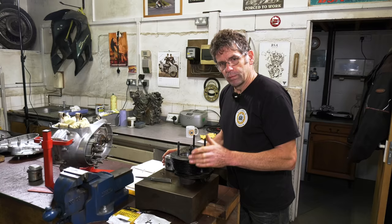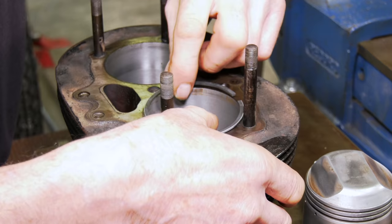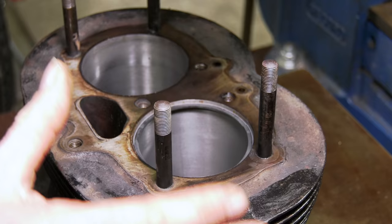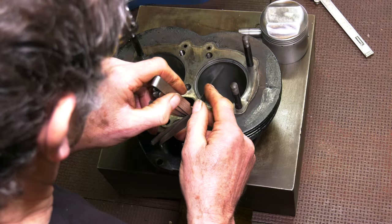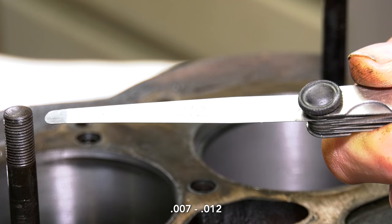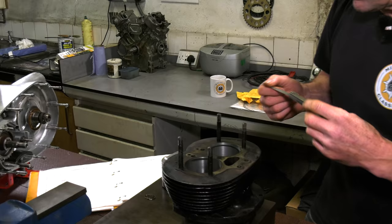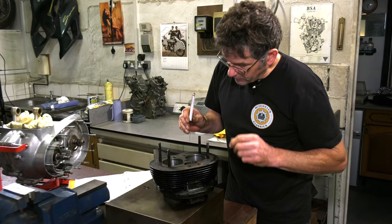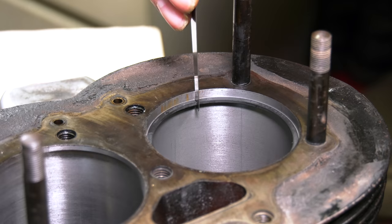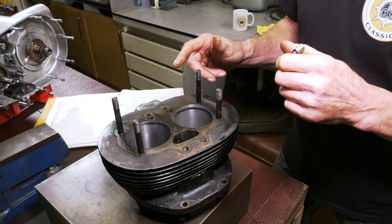Now, we know we've stamped up 20 thou oversize. We've got two sets of new rings. We've put the top ring in the bore here — it's so important to have the right clearance. There's got to be a ring gap. This is actually marked up in the book: the fitted gap is 0.007 to 0.012 — that's 12 thou. I've got 12 thou here. If it's slightly over it doesn't really matter, but you've got to have the clearance. I'm just going to put the feeler gauge in that gap — just a little bit grippy. That's quite serviceable. It's important to make sure you have the right rings, so always take a ring out of the packet, stick one in the bore, and just measure it up.